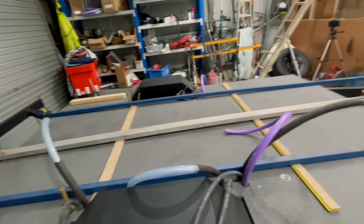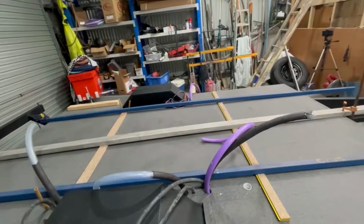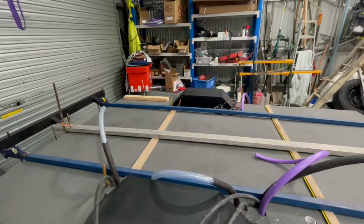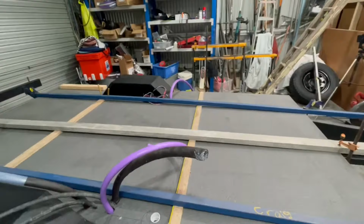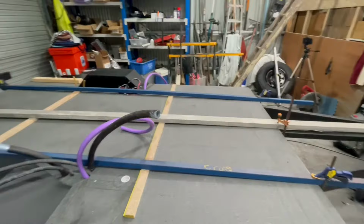So I put pressure on that spot and that spot, mainly where the joins are, where the boards meet, to try and pull those joins down. And when I put the straight edge on before, either end was a little bit lower than the middle because of that bulge in the middle. So I put heaps of cork on the ends and a couple of small packers, and hopefully that's going to rectify it. Still plenty of glue between the floor and the frame at those points. So I think we're good. I think it's going to work out all right.